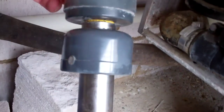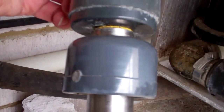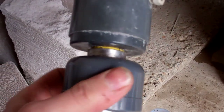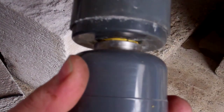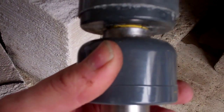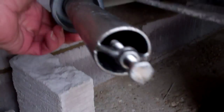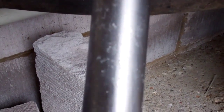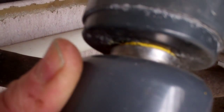I'll just come to check the level sensor because I wasn't sure that was working okay. See, that's loose - the thread's loose. And that lets the air pressure out from the tube. It fills up with water on the outside and the air pressure goes up, and that should make the little micro switch switch. But if it's leaking out around the threads it might not ever go off on the level sensor.